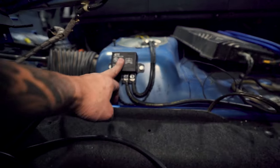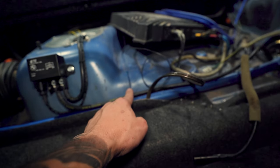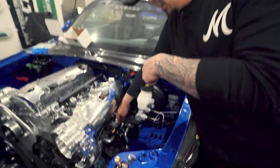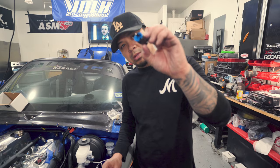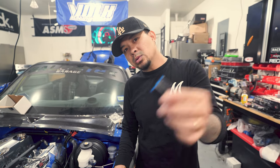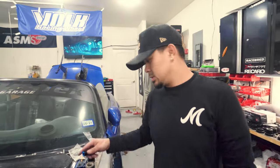We're done with our fuel pump wiring. This goes into the fuel pump positive and then this goes to the battery — it goes into this breaker and then from the breaker into the battery. This is the return line we created right here, and it goes up into the fuel pressure regulator. All we have to do now is get two more 5/16 quick connects so we can connect this to the OEM feed line into the E85 or flex fuel sensor, and then from the flex fuel sensor out into the fuel filter — and that'll be it. I hope you guys found this install valuable. Make sure you smash that like button, smash that subscribe button — authenticity is king. Peace out, I love you guys.